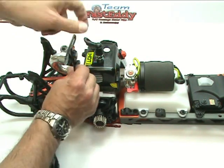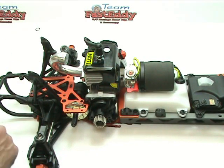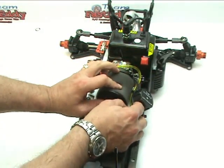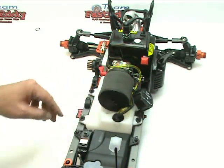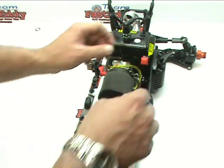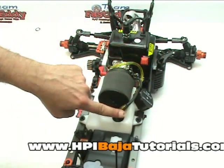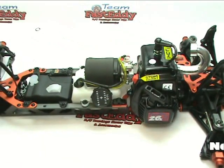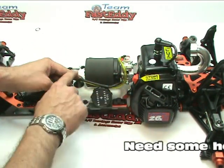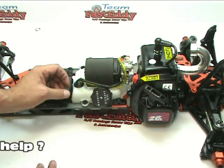The last thing we're going to do is revisit our fuel lines to make sure that they're routed properly and they're not being pinched off. The directions tell us that they should go up and underneath the air filter; however, I really don't like that location. I've never run mine that way — I've always just run them on the side like this. The reason I like that is that I can physically see every portion of the line to make sure that they're not getting pinched.